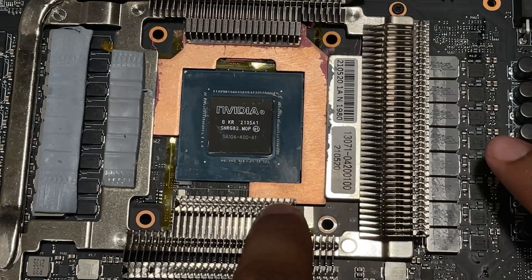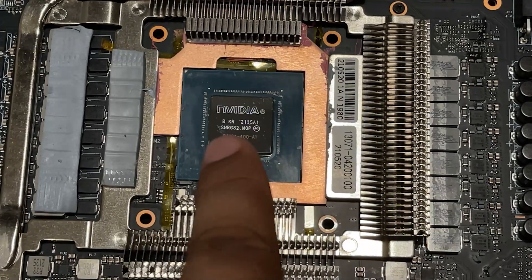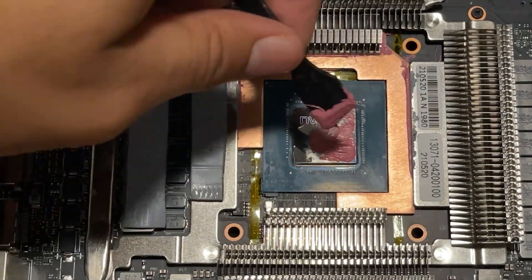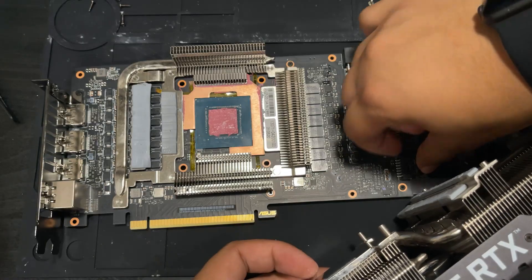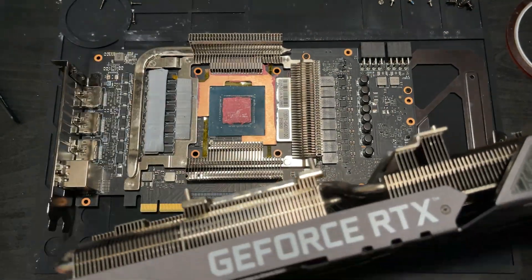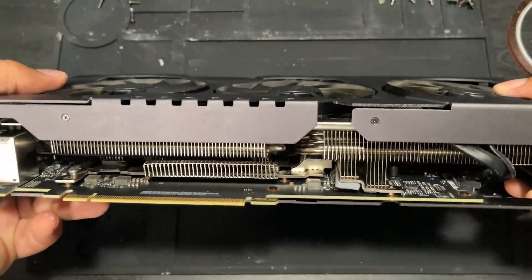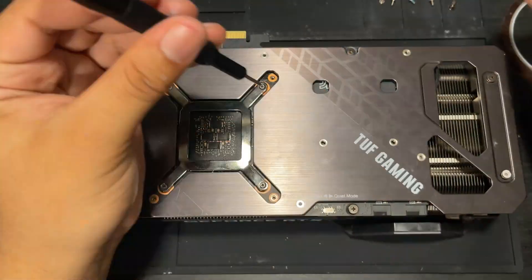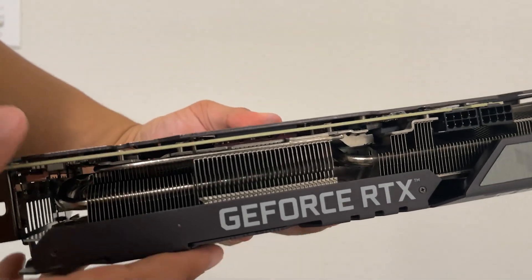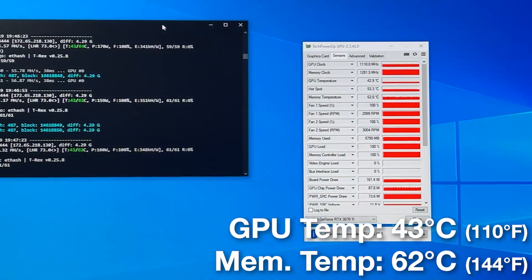In this scenario, using one little dollop of thermal paste will not work — if there is not adequate contact between the thermal paste and the copper plate, your GPU will overheat. A wonderful monstrosity — what it lacks in looks, it makes up for in performance. We're going to go ahead and install this sub-heatsink. We've made contact everywhere that needs contact. Our VRAM is completely covered and it is going to be completely fine. Let's reassemble this card and get to benchmarking — and of course, let's not forget to repaste the core.